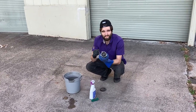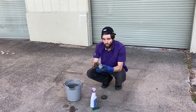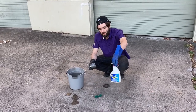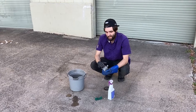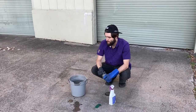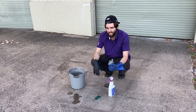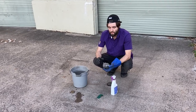I use different degreasers to clean out the insides and make that all nice, and now I'm ready to use a few-step process to polish them. First we're going to use aluminum brightener — comes in a spray bottle, spray it on, leave it on for a couple seconds, then scrub it around with a scotch-brite. After that you want to wash it off — make sure you wear gloves because this stuff is really caustic. Don't get it on your clothes or skin.